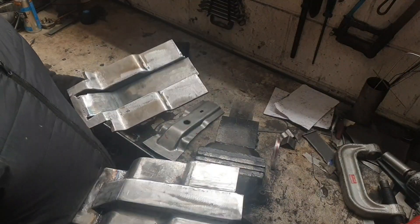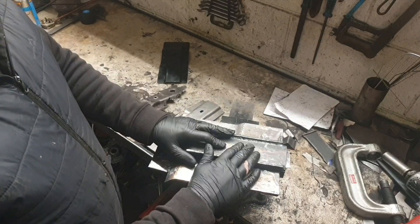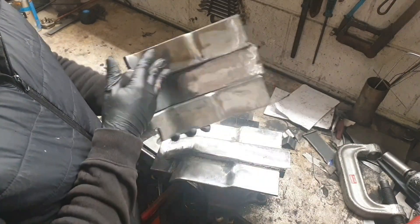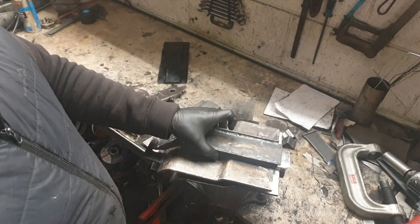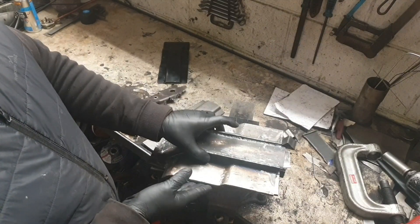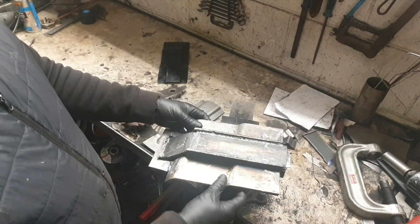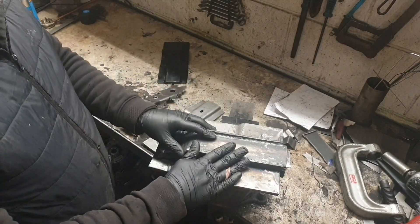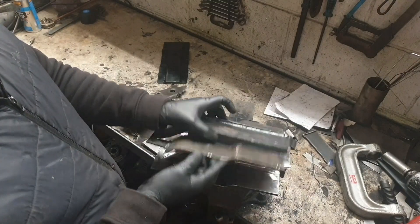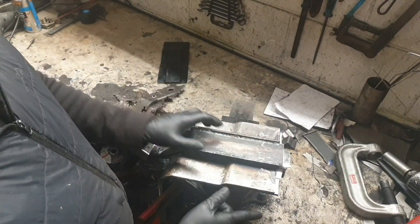Proper panel pressing dies are CNC machined out of big chunks of steel — big solid lumps, huge things, many many tons. And that's how you can get all the curves, like rear quarters and stuff like that. Obviously this is much more simple. I'm not suggesting you go and make your own rear quarter dies, but for floor pressings and things where there's lots of straight lines and angles, it's definitely a good way to go — much better result and a stronger panel as well, by pressing it.